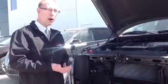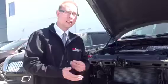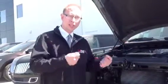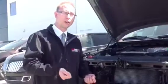It's all drive-by-wire technology, meaning there's no cable for the throttle. It's all done by an electrical signal. Your benefit that way is you're going to get good power right away. Cables tend to stretch and wear out over time. It's going to give you good response for getting up, passing, and whatever you need to do that way.